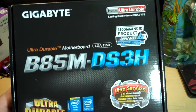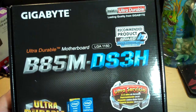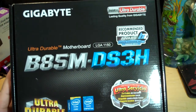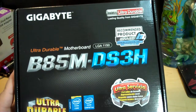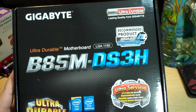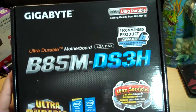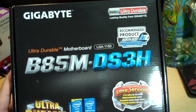The reason that I picked this one in particular is because it supports PCIe 3. That way you can have a modern video card, a modern GPU — all the way up to the biggest, craziest 900 series NVIDIAs if you wanted to, or something a little bit more modest — but you get the full bandwidth available for PCIe 3.